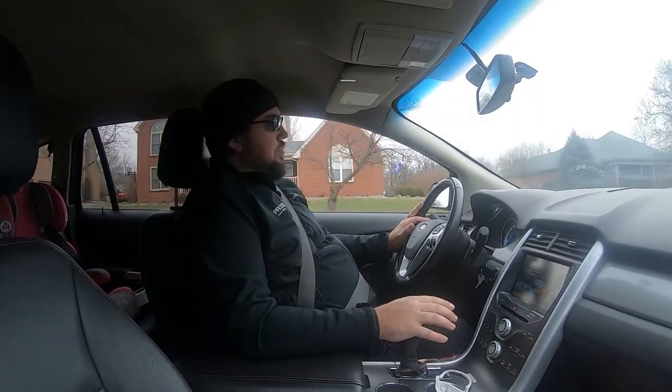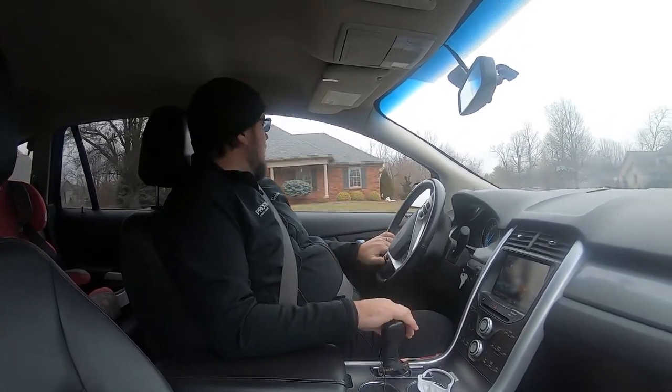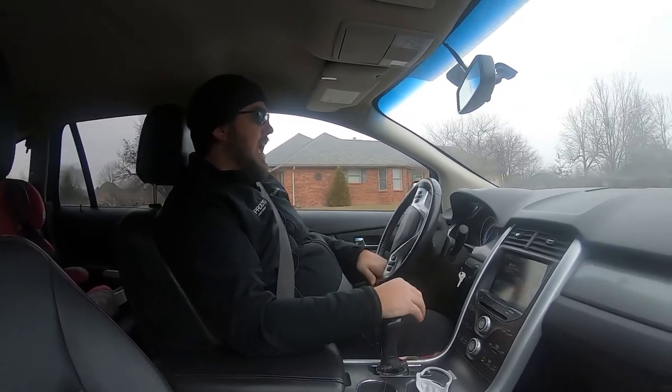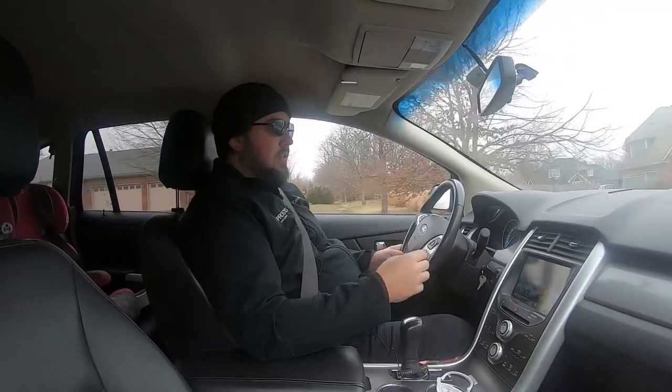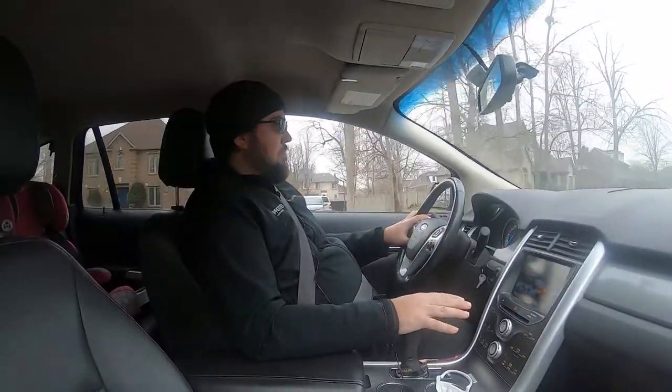So the issue with the larger oil filter cap is the oil filter is only so long. It's a cartridge style filter, so it slides down into this housing. It doesn't screw on like most cars that people are used to. I know a lot of you might be Powerstroke owners, and I knew this, shame on me.